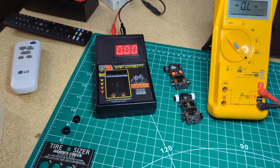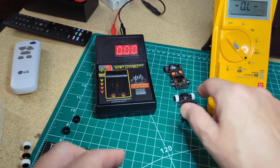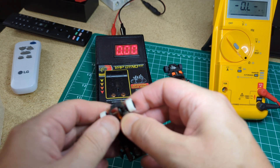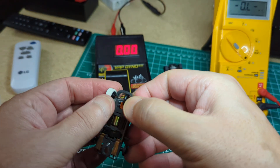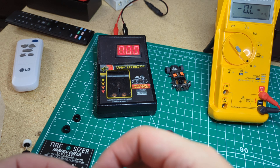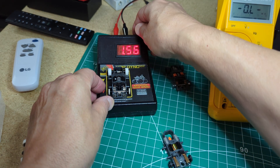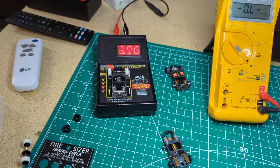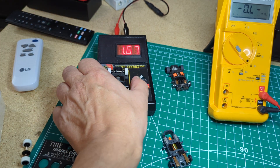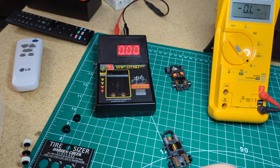I forgot - let's try the 22 tooth gear. Maybe I'm missing the basics here, because all of my low ohm cars are running higher. With the 22 tooth gear it gets us up into almost the fours. Still a little off though. I mean, don't get me wrong - it's still a very fast car.